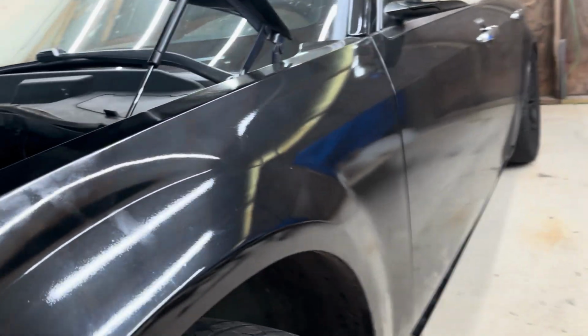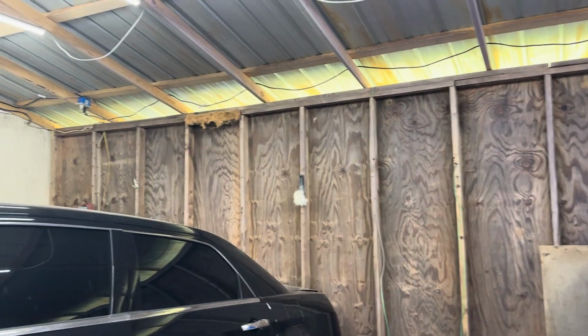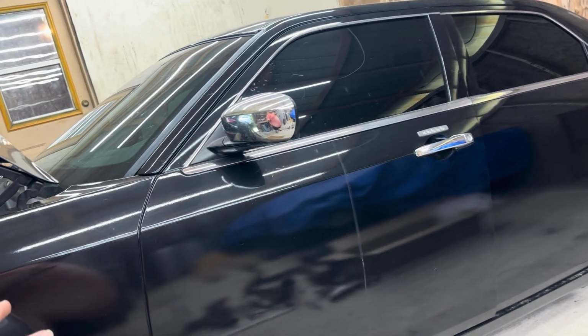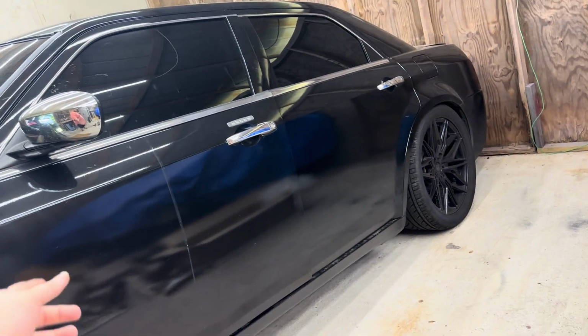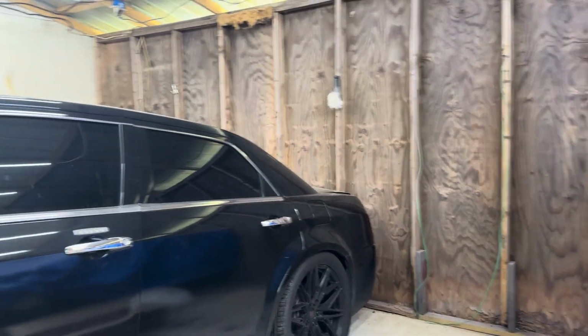So you can see that one down in there. Now, I might have to raise the car a little bit because of the, I don't know, we'll see. The flange, but I have all my stuff in. I think I'm gonna have the exhaust shop do 3-inch on the car instead of 2.5, which the X pipes and everything I ordered are for 2.5, but I don't think it'll be that big of an issue. But 3 should give it a little bit deeper of a tone.